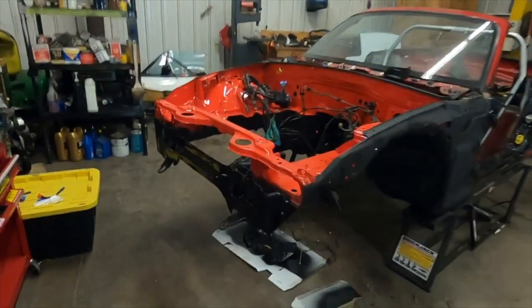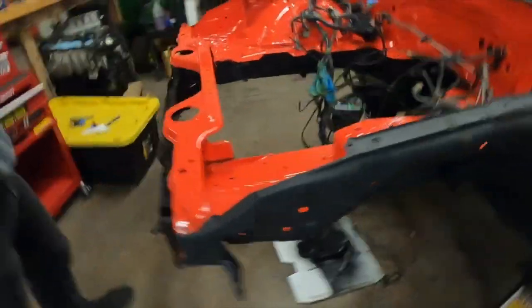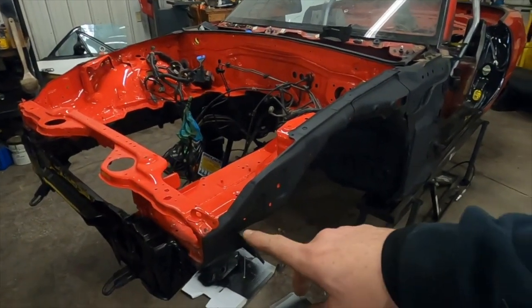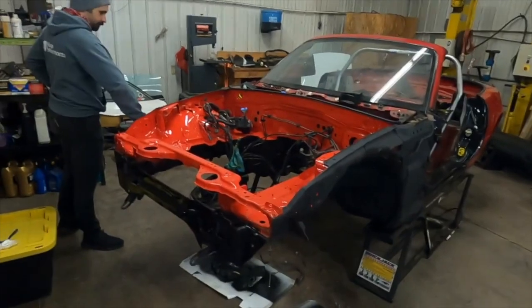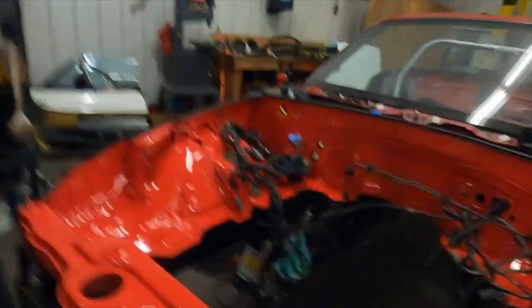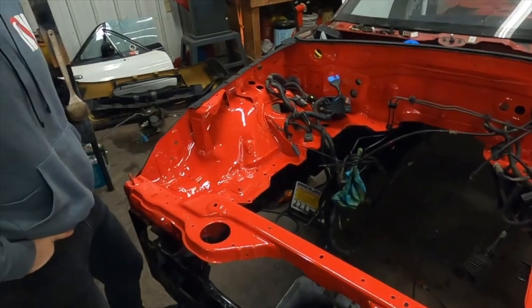Let me show you what we did to the shell that we didn't film. Yesterday I taped everything off — it looked like Dexter in here. If you follow us on Instagram, you definitely saw it. And then undercoated all of this — it's Rust-Oleum bed liner. One thick coat is all it took and honestly it looks sick, it's super clean. We're going to do the rear end later once we get to the back end stuff. Dylan sprayed this all black a couple of weeks ago, so everything down here is nice and clean. Honestly, way too clean for a track car, but we're going to roll with it.